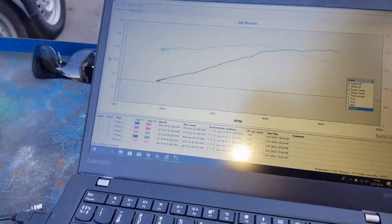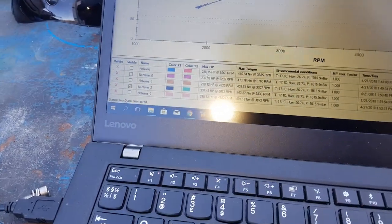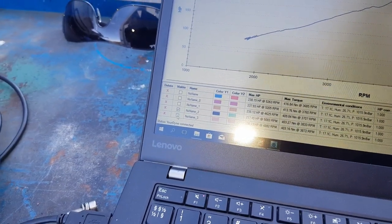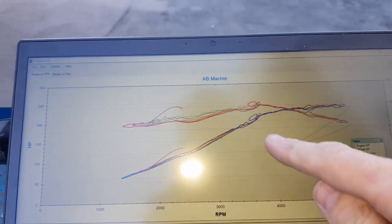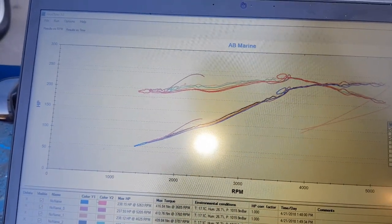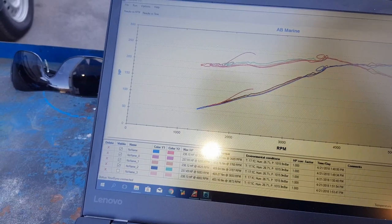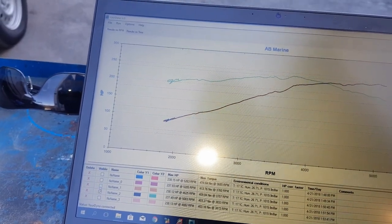Here are the results. As you can see the curves look pretty good — around 238 horsepower or something like that. You can see all the different runs we did with a lot of different setups — different flow, different parameters for the PIDs, etc. In any case it's pretty close. If we turn on all the curves we can see some effects where the brake had too much KP and KI and got a little bit unstable, but you can see with all these different parameters it still overlaps pretty well. So we found the best parameters; this is anyway just some early testing and we will test more.